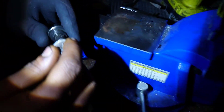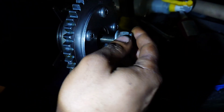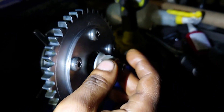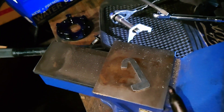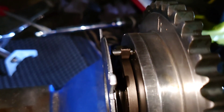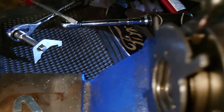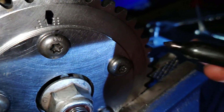Before we take it off, we're going to use the old cam phaser bolt and a nut just to hold everything together in case parts start flying off. Before we take them off, mark them — do we have a sharpie? Before we use the com cam tool, you want to mark where the pins go so the J-hook and the pin are going to be where these numbers are, so just mark it, and then the second one.